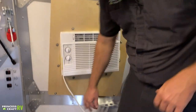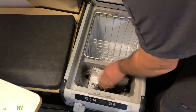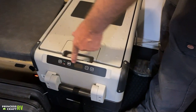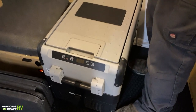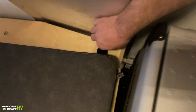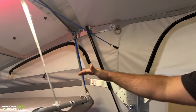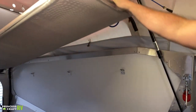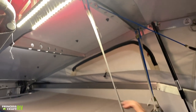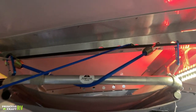Just below the air conditioner is your Dometic refrigerator, which runs on 110 or 12-volt and comes with both power cord options. It has a power button, temperature control buttons, and a setting button for different functions. To run it on 12-volt, the accessory port is right behind the bench on the off-door side. Your overhead berths have a weight limit of 130 pounds maximum — whether using them for storage or for kids. They hang down and store up with a bungee cord that hooks into holes engineered into the roof rack.